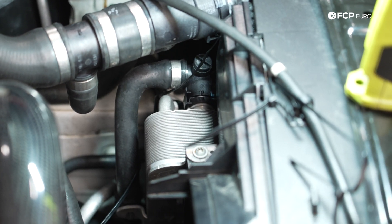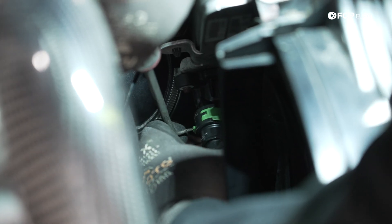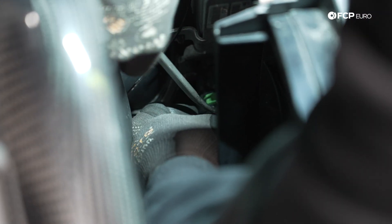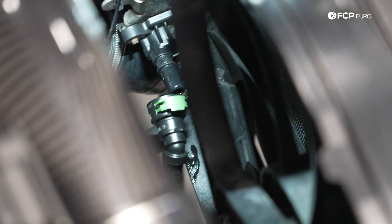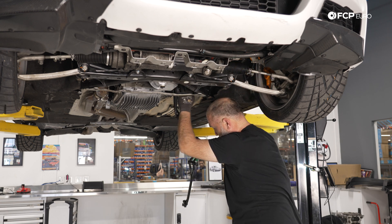We just push that upper trans cooler line off because it's not locked. This lower one is locked — these locks are awful. I hate these from BMW because they are a quick connect, but they do not come apart as nicely as they go back together. You basically just have to push the center out. I'm not going to be too careful with these connections because the lines come with new ones — that's why we're replacing them. When you pull it up far enough you'll hear an audible click, that should be the neutral position, and then you rotate and twist the line off and it should just come off. Now we should just be able to snake the whole assembly out of here.